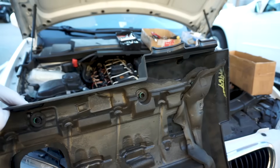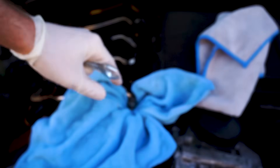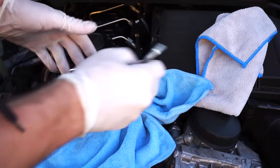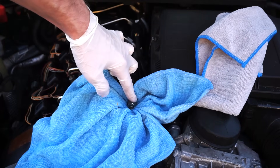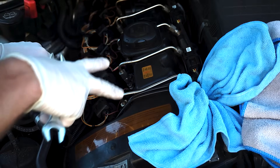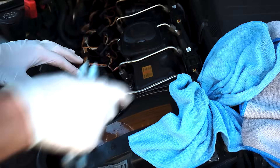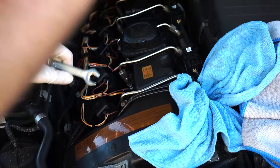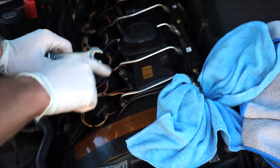Perfect, looks brand new. It's 17mm and 14mm — German stuff. Make sure you put the right tool under the fuel line and crank it up just a little bit, just a touch, to release the pressure. Then remove the two lines from the injectors — whichever ones you want to work with — or remove the whole line. It's basically a couple more screws in the back and then you just flip it out. That's the 17mm big one.